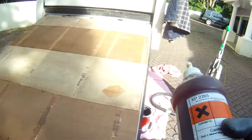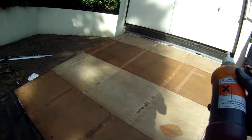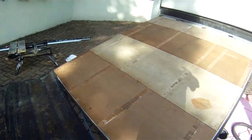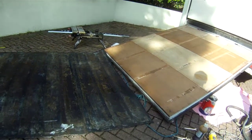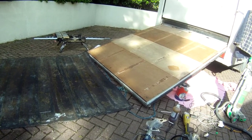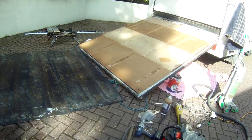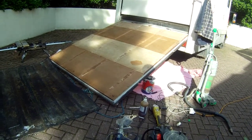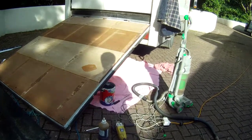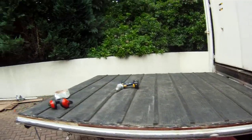So I believe this is the recommended adhesive for the job. So I've got the rubber mat lined up, and I'll pull it into position first, pull up the ramp, mount it on the Black & Decker Workmate bench, roll over one side, put on the adhesive, roll the rubber over, and then roll up the other side, put on the adhesive, roll it back, and then put on the edging strips. Right, that's the mat refitted.